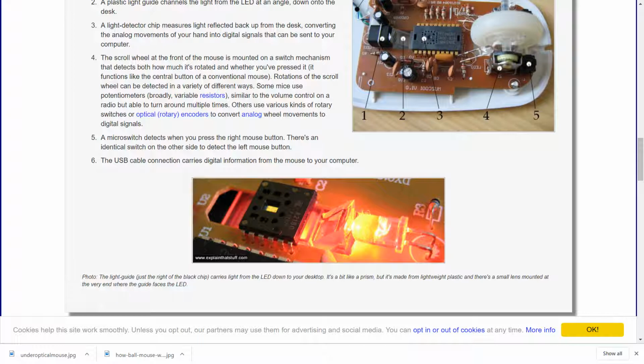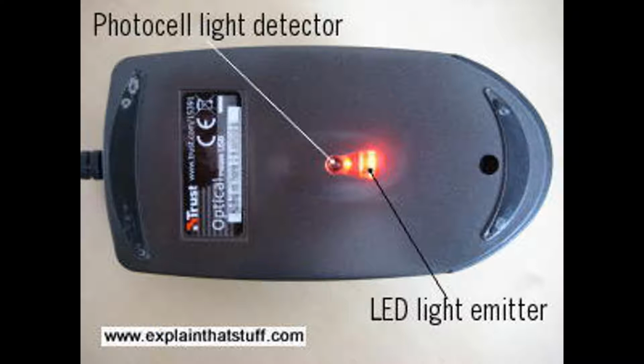A wireless mouse basically sends data to your computer using a wireless connection, typically Bluetooth, instead of a USB cable. USB doesn't only carry data, it also provides the power for a small plug-in device like your computer mouse. Without that power, wireless mice obviously need one or more batteries, which adds a hidden running cost, and makes them slightly heavier than wired ones. Not that that matters much when they're on your desk.